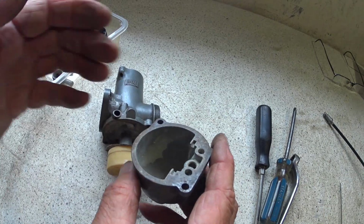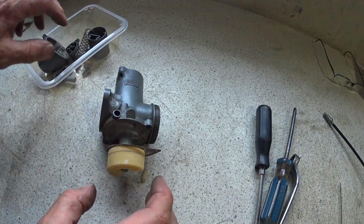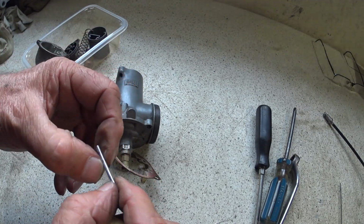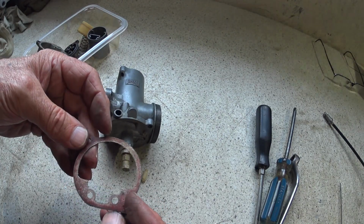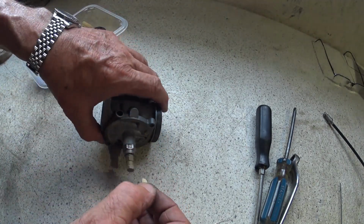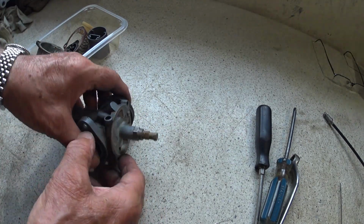Oh yeah. Plenty of sand or whatever that is. Yeah, it's quite badly cruddied up. So, definitely a Mark 1. Got the hollow float. And got the horrible nylon main valve, so I can't really put that back anyway, because you should really have the ones with a Viton tip, because they do give trouble. Let's keep going anyway.